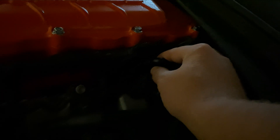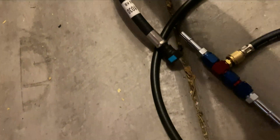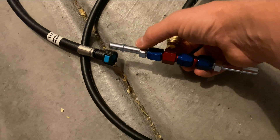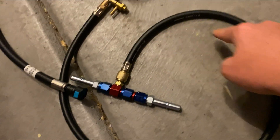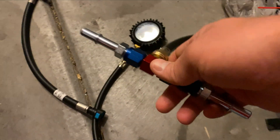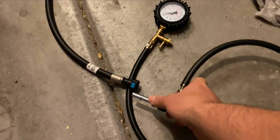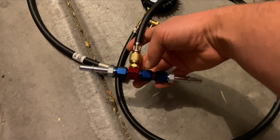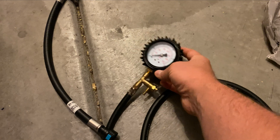So I came up with this — I'm going to tap in right where the fuel line connects. I'm going to disconnect that and then use the Whipple-provided three-eighths quick connect fittings. I'll put that on there, and then this goes to this piece — these are three-eighths lines. It will quick connect there, and then the other fuel line will quick connect here, and then I'll be able to attach the fuel pressure gauge that way. The kit I borrowed from AutoZone and O'Reilly's has a one-fourth fitting and it's just too small for those three-eighths lines. So I went to a local speed shop and the guy put this together for me. Now I can test it using this mechanical gauge instead of all the electronics.